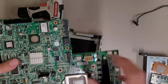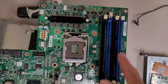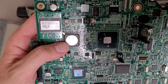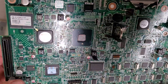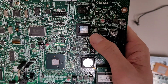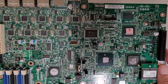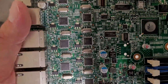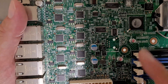Here's the motherboard. Not much to see — this part of it seems to be just bog-standard motherboard stuff. There's a Cavium chip there, doing probably firewall processing. Boot flash — basically a USB flash drive. An Avocent sticker there; I think they do KVM stuff. A PLX chip there, and then a bunch of Intel network chips — probably all individual gigabit network controllers, and they're probably all feeding off that PLX chip.